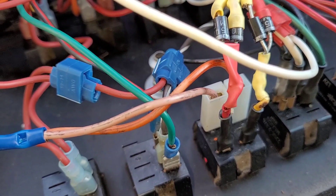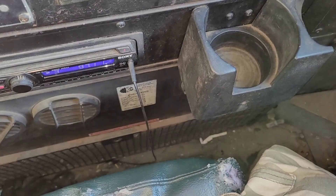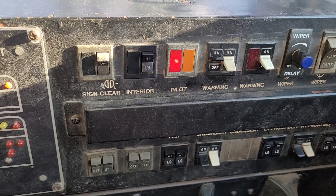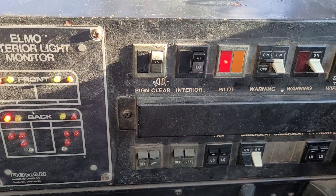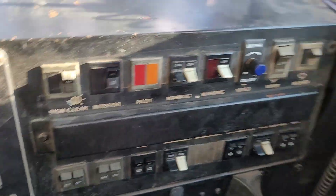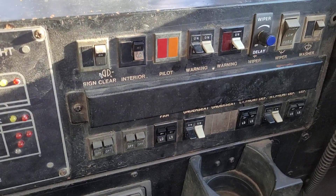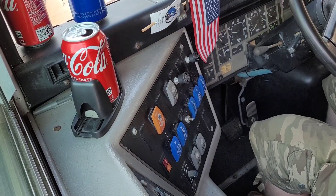The light that wasn't on was what it grounded through. With LEDs that's a problem because it makes your LEDs that are not lit up come on very dim, and that's bad for the drivers. That's how you burn out LEDs — the drivers that bring the 12 volts down to whatever the LEDs run on. So we've got his bus right here and we're going to go in and solder some diodes in.